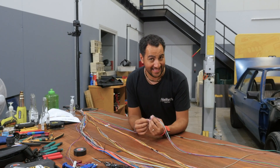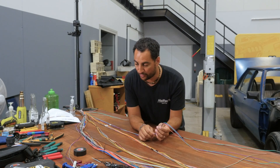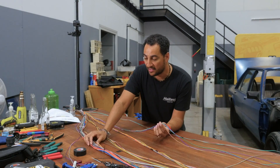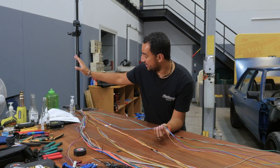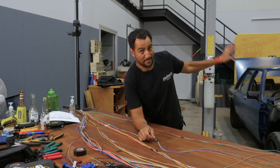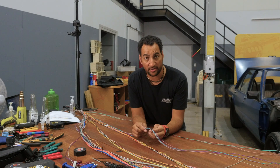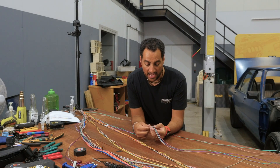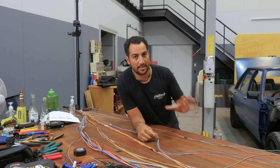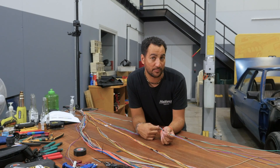I'm not sure what to do about this next group of wires yet, but again we'll do some more planning and figure out where they're going to go. These are going to run to the rear of the car. We're not going to use the designated fuel pump system inside the loom — instead I'm going to use the fuel pump output wire for the starter motor. That wiring's already been done within the fuse box. I'm going to run a fuel pump output to the rear of the car and set up a new fuse box back there. The fan for the transmission cooler is going to run to the rear as well, controlling the relay back there too. And another relay I'm going to set up is for the power steering — we're going to control it so we can map it against vehicle speed.